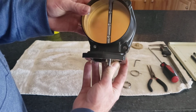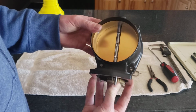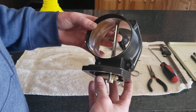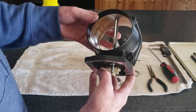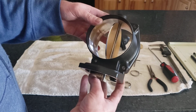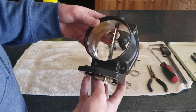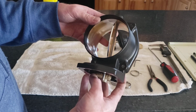So the valve will only close in this setup when the eBoosters come on. And any other time, when the eBoosters are out of steam or when they're not operational, the valve will default to open. Whether it's the natural resting position or I move this blade to go fully open, I'm not sure it'll make much of a difference. This is a 102 millimeter throttle body. My charge plumbing is 3.5 inch, so this is about a 4-inch valve. So the valve will definitely not be the limiting factor or a big restriction really at all in the system.